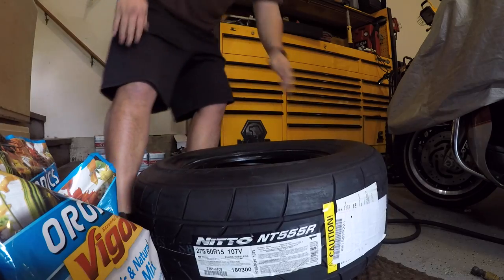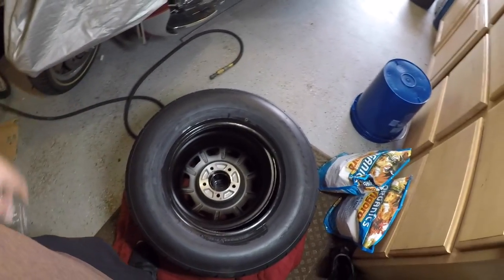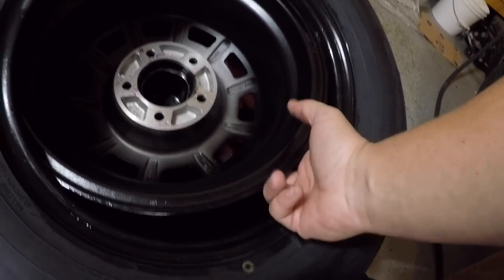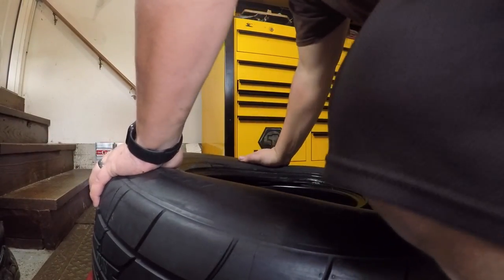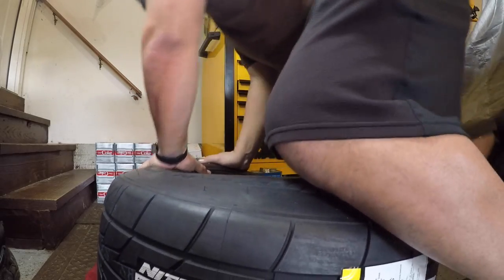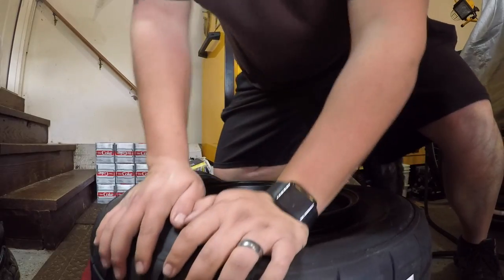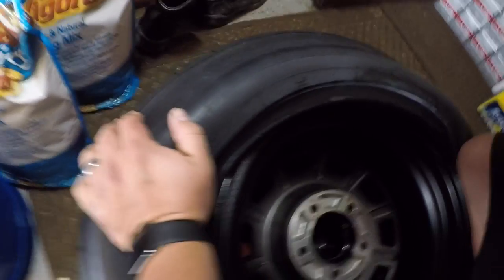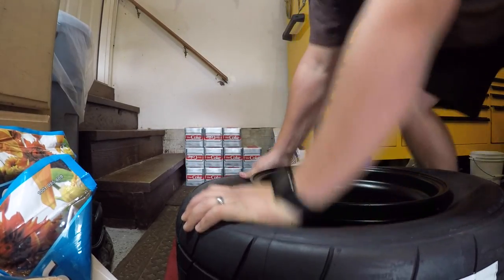Just like that. Now this is the hard side — you'll see I might have to chase the bead around the whole thing. You start by getting this piece of bead right under the lip. You can see there's a lip here — you get it caught there and that'll hold that end. Then you use your knee and your arms all the way around. This side is going to be stuck because it's catching under the bead, so then you can do the other side easier.